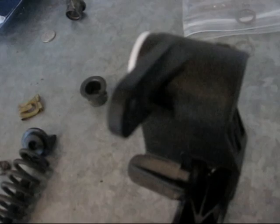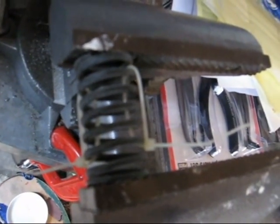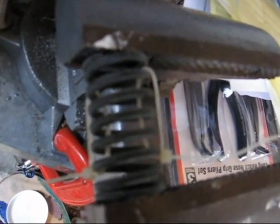You want to use some kind of grease that doesn't run when it gets really hot. If you park your car out on a hot day, everything heats up inside especially. So something with a high temperature rating — maybe brake grease. Then we're going to start putting it back together. Putting the spring back in, I'm going to use the suggestion that UUC explains: take a couple of zip ties, put the spring in a vise — be careful, it's under a lot of pressure when you close it up — and then tie the spring so it's shorter and it should go in easier.